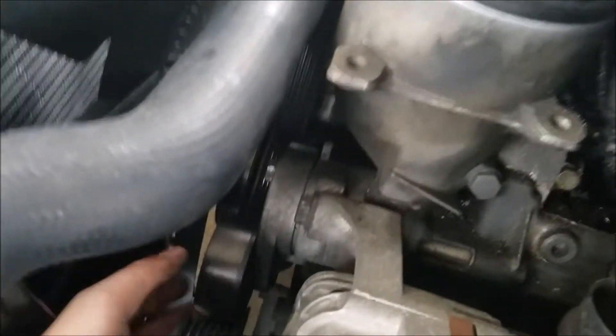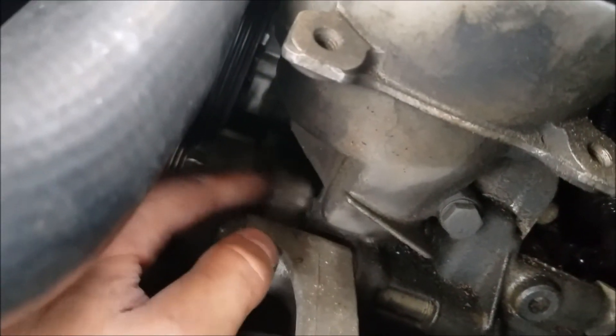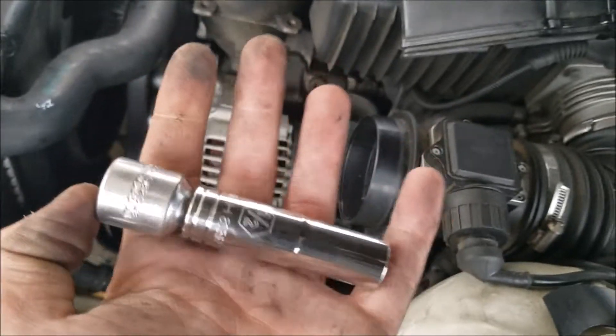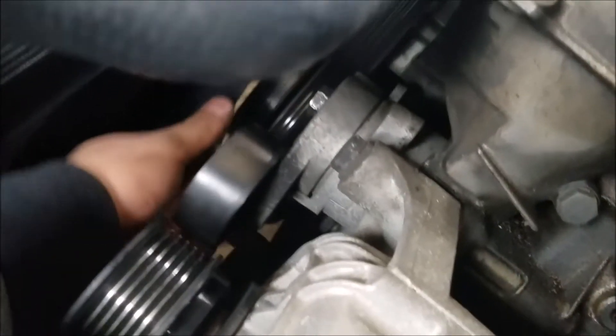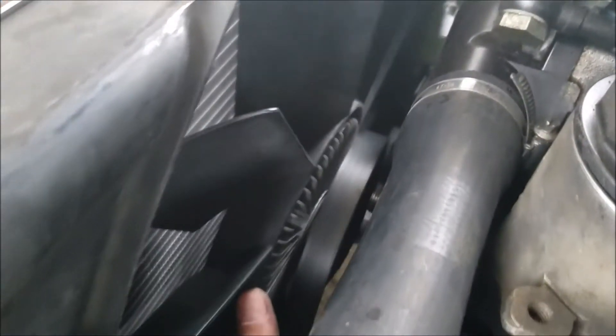To remove these hydraulic tensioners it's pretty easy — it's a 13 millimeter socket. There's one bolt that's more difficult to get to at the very bottom where my thumb is, and then one more right here which I already pulled — that's the easy one. To get to the bottom bolt I used a small breaker bar with a long half-inch or 13 millimeter socket and an adapter to get enough clearance. Pulling the fan off gives enough room to remove everything.